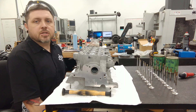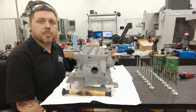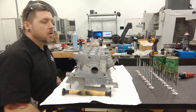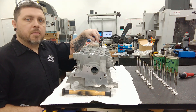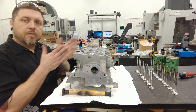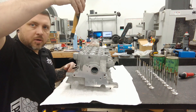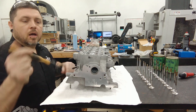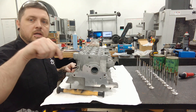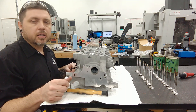I'm probably going to try just starting out with the 400 grit and see how they lap in. The seats look like they're in pretty good shape so I don't think we're going to have to take much material off. Basically the way this goes is you drop a valve in, you put a little bit of lapping compound on the seat, and then you spin the valve. It's a suction cup, it goes on the valve — you spin the valve basically until that abrasive cuts into the seat and the valve enough to where they match and they get a good seal.